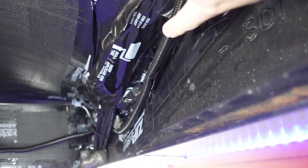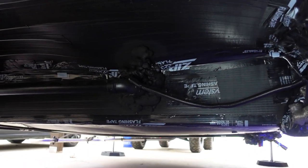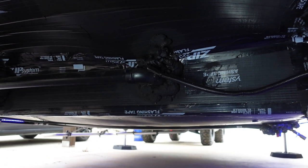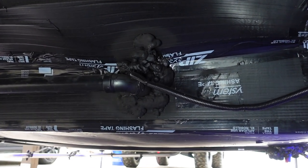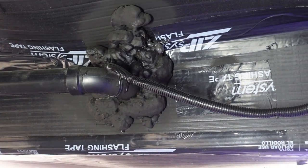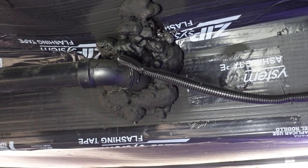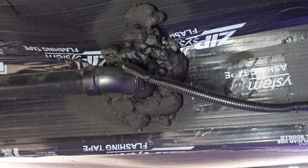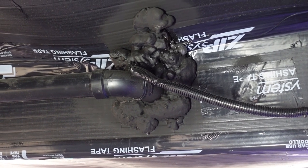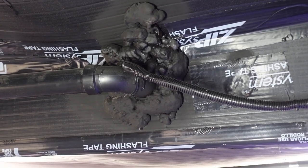You can see that black wire loom, and these are all the hydraulic lines — at least on my floor plan — coming out of there, sealed up with zip tape. The wire loom chases all the way around the corner and goes into where the sewer goes into the drop section of the frame into the underbelly. I did that because there's solid metal behind this bulkhead where the frame drops for storage, and you don't want to drill through metal unless you have to. It was easy to slip that single strand of wire right through where the expanding foam is, right where the gray tank sewer goes. I could then grab it from the inside and take that wire over to the BM Pro system and join it to the awning number two channel.